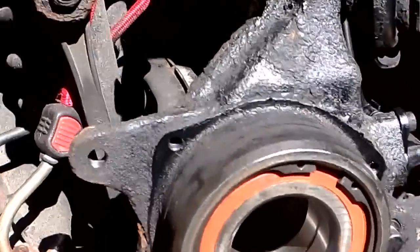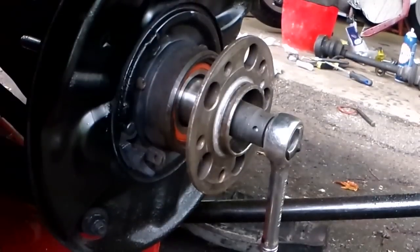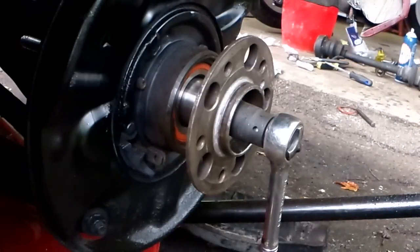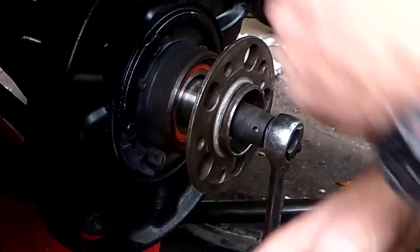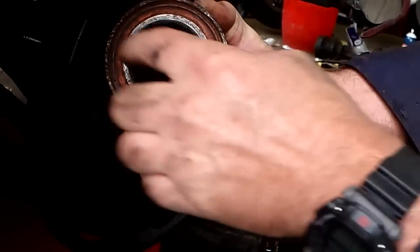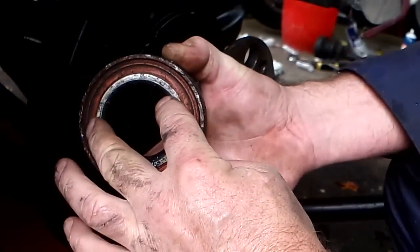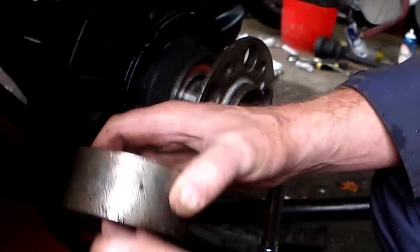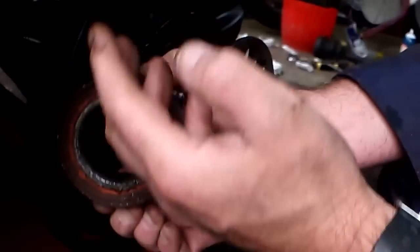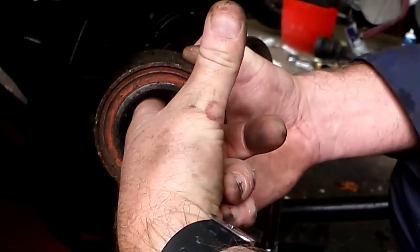This is now about day five. I'm on the other side. I'll show a different method for pressing the hub in — using a 5/8 threaded rod with a bolt and washers. When putting a hub bearing in, you want equal pressure on both sides — that's why you don't hammer them. If you hammer, it'll go halfway through and once it hits one half it'll just pop that half out. You have to press them with support from the back. On the other side I used the axle shaft spline poking through to hold from the back, then pulled it on with the center nut.